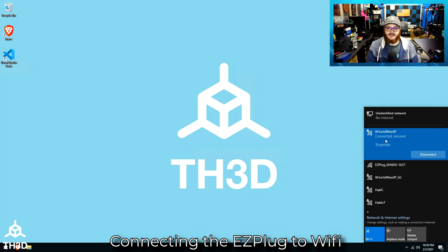Once the Easy Plug boots, you'll see a Wi-Fi network in your list that has the name Easy Plug in its name. This is the one that your plug is broadcasting. I would recommend setting up one plug at a time, as it can get a little confusing if you're trying to do multiple at the same time. I have two separate networks for my Wi-Fi — one is 2.4 gigahertz.